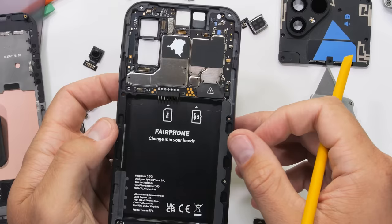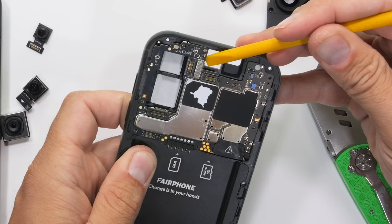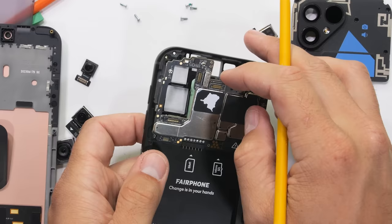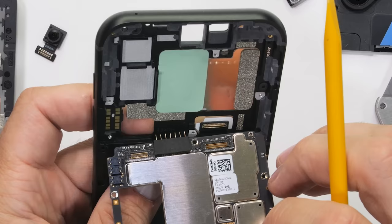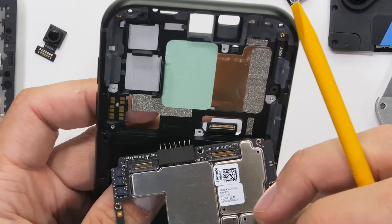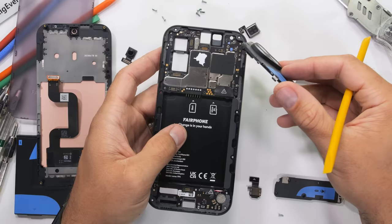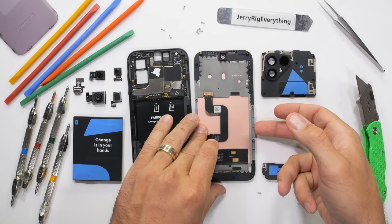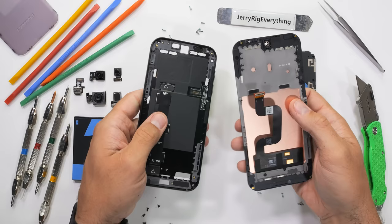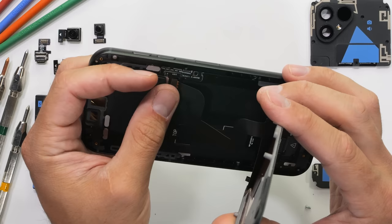One thing I didn't quite understand at first: the SIM card and microSD card slot are listed as being located on the motherboard, but they weren't immediately visible. Taking a quick peek behind the motherboard reveals a cool copper vapor chamber as well as a teal thermal pad in place of thermal paste. Removing the motherboard isn't part of any standard repair procedure — this is just exploring. Turns out the SIM and expandable SD card slot are located on the back plastics, and the Fairphone 5 is upgradable to a mind-blowing 2 terabytes of storage.